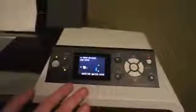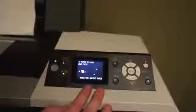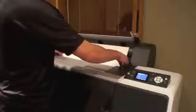The printer is ready to accept paper when the orange light is lit in the upper right-hand corner. Also, sometimes it's easier to turn down the suction as you're feeding the paper, so you can go ahead and do that as well. Once everything's all set, go ahead and feed the paper through the top of the printer and feed it until you see it comes out of the bottom.